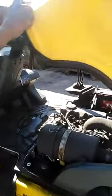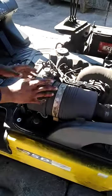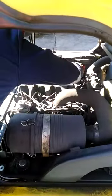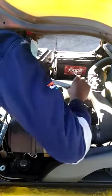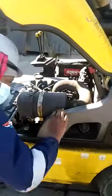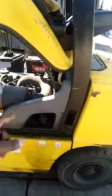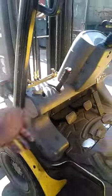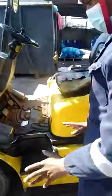Then we open the engine. We check the filter, if the filter is not blocked by anything inside. Then we check the gauge, the dipstick for the oil. We check the engine oil also. The fan belt, the fan, the other side position, the water — if there is no leakage, the level is good with no leakage. Also we check the brake fluid, if it is on level and no decay.